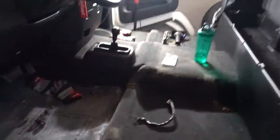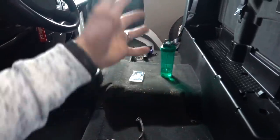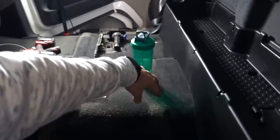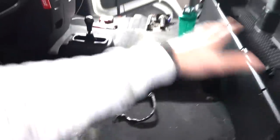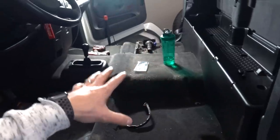Without any exaggeration, it took me all of 10 minutes to remove the stock seats. Four bolts on each side, eight bolts in total, and then you've got six nuts that hold in the center console. You could take the whole assembly out in one piece if you had additional help — in this instance I don't, so I did separate them. Really not that hard, though: two bolts on the back of the center console on each side, and then one bolt on either side up front. I'm actually going to get everything nice and cleaned up with our handy-dandy shark over here before I reinstall everything — you don't get this kind of access every day.